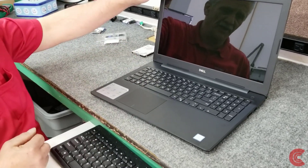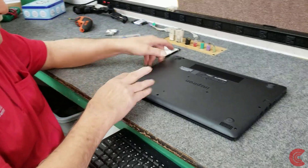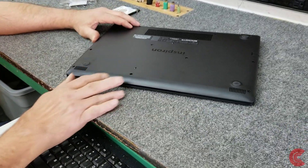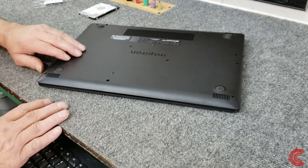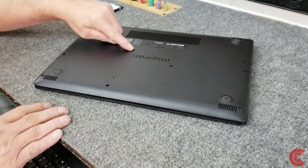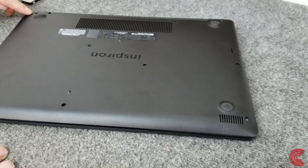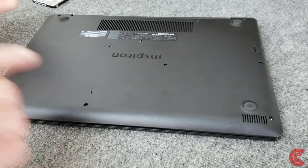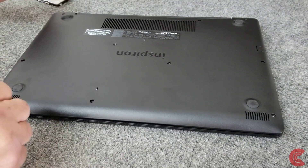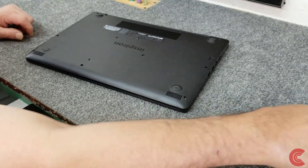So it's a pretty simple little upgrade — the bottom panel comes off. I've already removed all the screws. One thing I want to point out is there are different size screws on these Dells. This screw right here is one size, these three screws along the back are one size, and the rest of the other screws are a different size. So make sure you put the right screws back in the right hole so nothing pokes through. I'm going to go ahead and open it up.